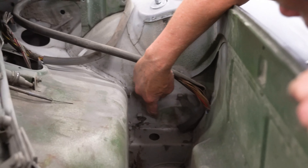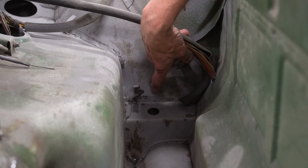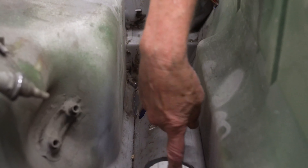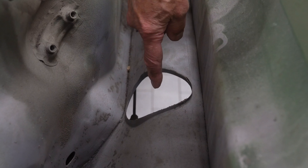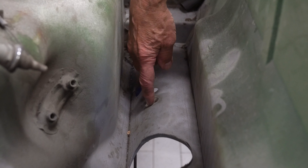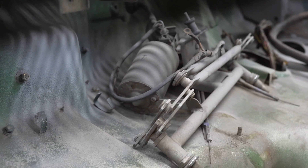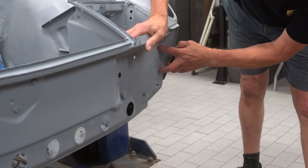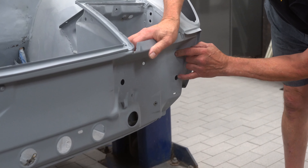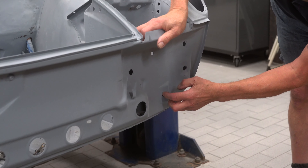The well for the gas tank is down in here. You can see the factory had been planning to put sway bars in here because the bodies were stamped for these, but sway bars didn't occur until 72 six cylinders and 73 through 76 914 four cylinders. Rack and pinion goes through here — notice it's centrally located. They could have actually made this left or right-hand drive since the rack and pinion is through the middle, but they never did. They only made the 914 in left-hand drive. These are the holes for the two master cylinder grommets that go right down through here to feed the master cylinder.